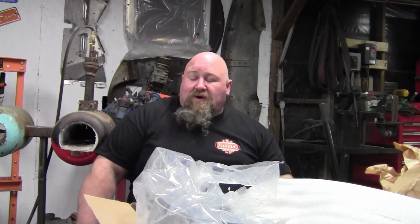to do the little small welding with. Watched a lot of Fitzy stuff lately, and in one of his videos he said you use .023 wire, and that makes a lot of sense. In his last video I was watching him make those hood scoops, and I'm like, I think I'm using 35, maybe 40 thousandths wire in my welder. It's too much thickness. My big welder doesn't use 10-pound spools. It uses 50-pound spools. So I can't justify having a 50-pound spool of .023 and a 50-pound spool of .045, and I have the other welder, so I'm just going to get the other welder up and running, and we're just going to use it. It's perfect for doing exhaust work and body work and stuff like that.